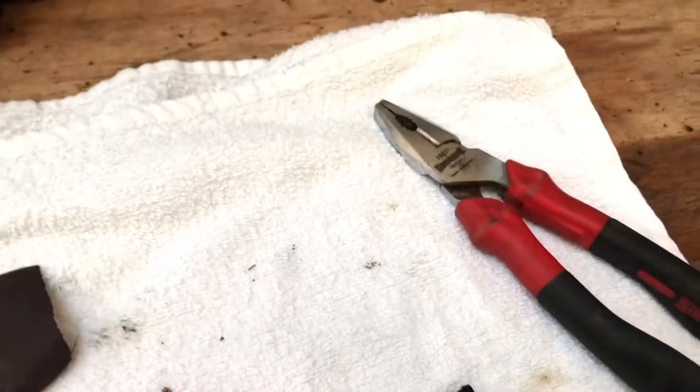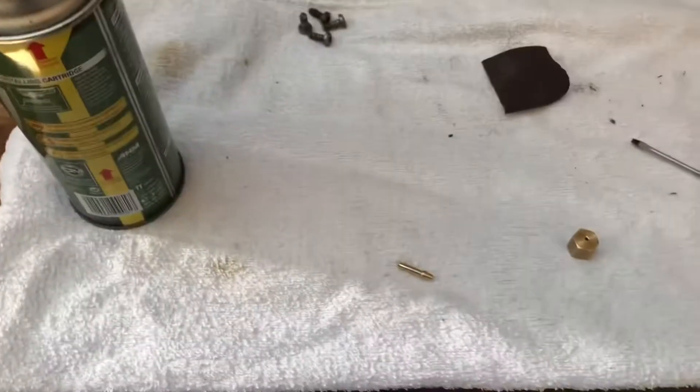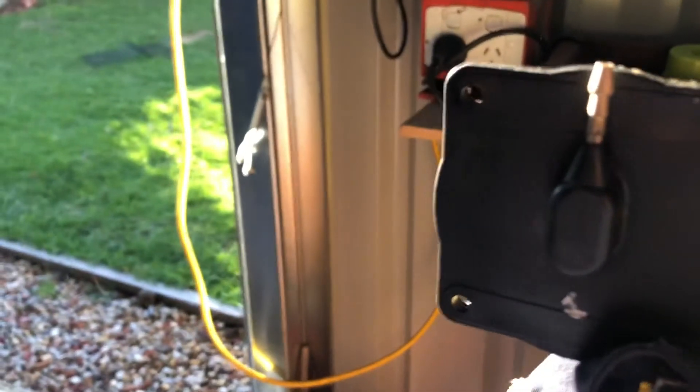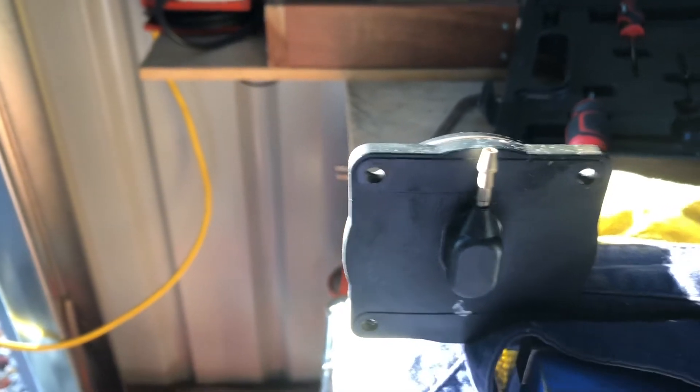So I've got my little gas torch here — not on the nipple bit — and some pliers to hang onto it. I want to move everything away, especially this thing, while I heat her up. Dealing with fuel, yeah, you know the story. Got that little nipple as hot as I could. Drilled the cap out in the end — drilled the top bit of the cap out at 2.5mm. Heated her up and pushed it in there. Seems to have sealed all right.